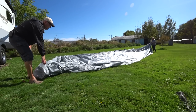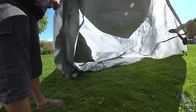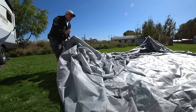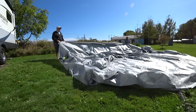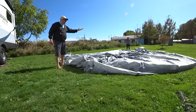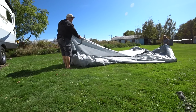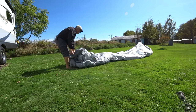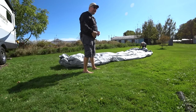You also have cinching-style tabs that are extra heavy duty, allowing it to be snugged front to rear. Now we're going to stage the cover. Once it's laid out, we've located the front up here. We're going to move one side over as much as possible, then grab the other side and rotate it, then pull that side in the opposite direction — staging it correctly. Now you can see the roof part is in the middle, which is the part facing the weather, and the two sides are rolled on top of the roof. Then we roll the entire cover from rear to front so it unrolls correctly.